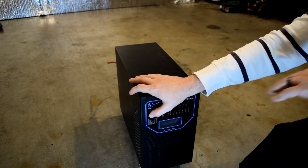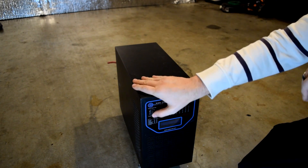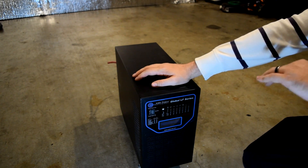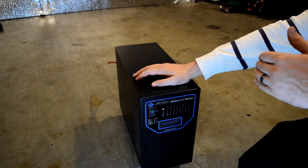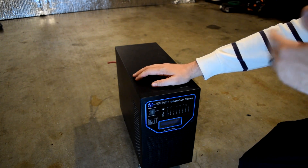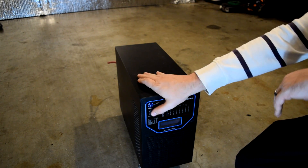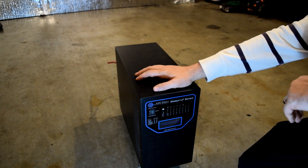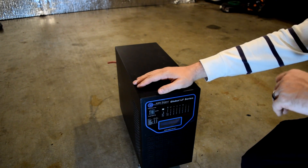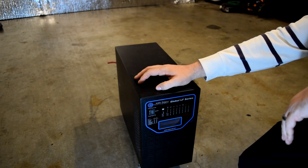When you want it to run no matter what — for instance if it has a power saver issue with light equipment like a small laptop — you can turn it directly on. In that mode it's always on. In power saver mode, it turns off for 30 to 40 seconds, checks for a load, then turns back on. When it detects a sufficient load, it will automatically turn on. For power tools you'd want to turn it directly on.